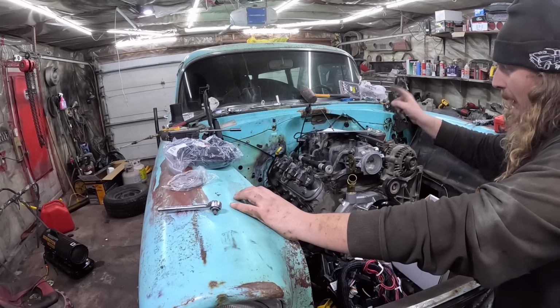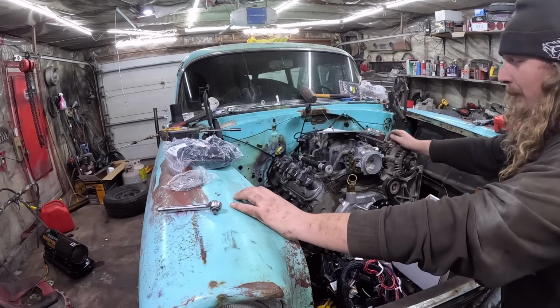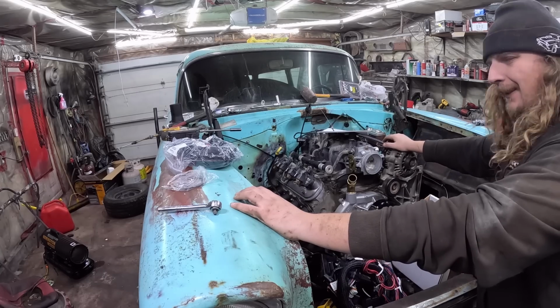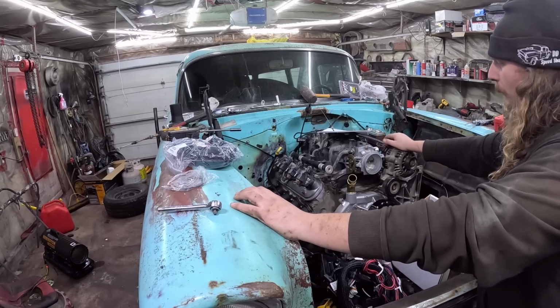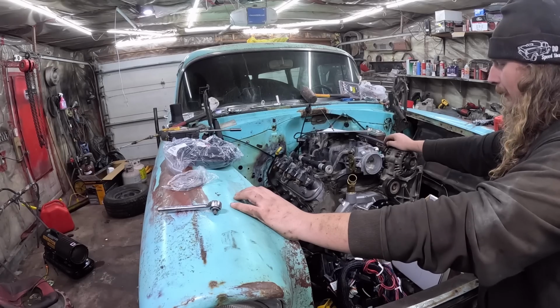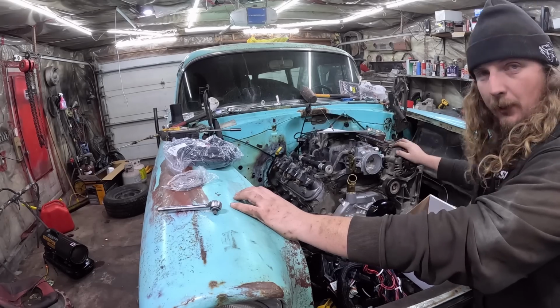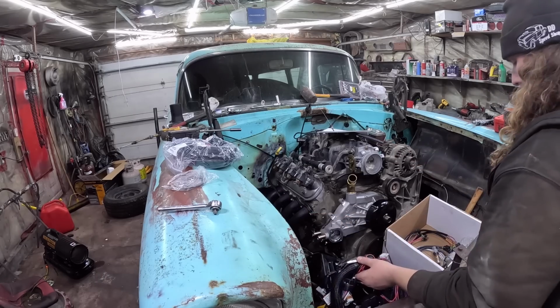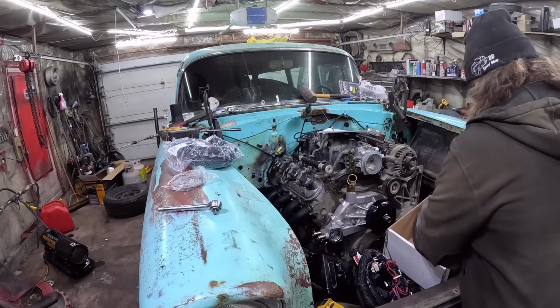The black car, we did Power Tour with it, put a bunch of miles on it, and it was having this issue where it's kind of dying and starting, right in the last day, or actually when we were coming home. And I was like, that's weird. And as it turns out, one of the grounds came loose. So it's pretty important, and you don't want to lose that. So you have this big mess of wires. I'll show you that in a second.